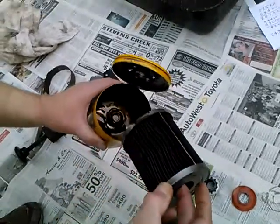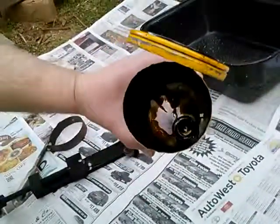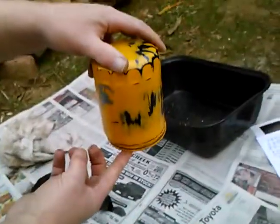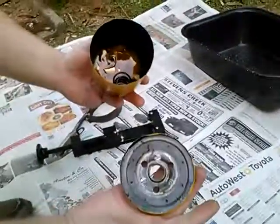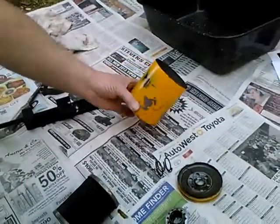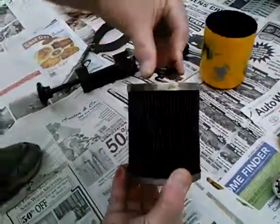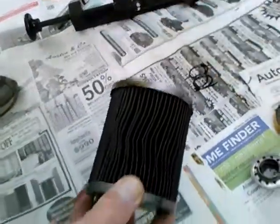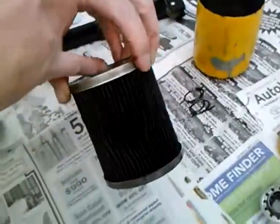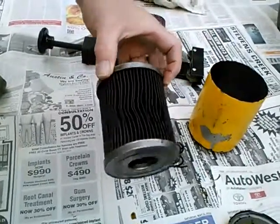Here's the element. In the canister, I don't see any buildup of debris. Now, this is mounted on the car inverted, but I don't see a big pileup of debris on the bottom here either. There's a spring inside that held the media inside the casing. As I was saying, if the pressure relief is here and opens, any debris might wash out and go into the engine — so that might be something to think about.